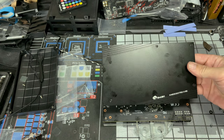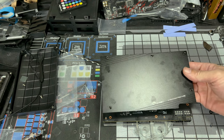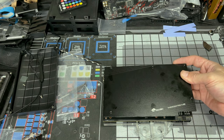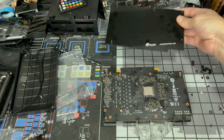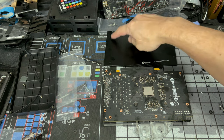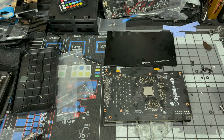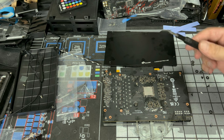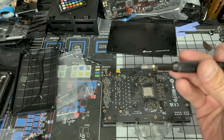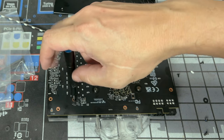If you look at your backplate, you're gonna see 5 outer screw holes, or however many you see on yours. So you're not gonna wanna screw those. You're gonna screw the ones on the inside. So just leave this here as a reference, and you're like, okay, I don't wanna do that one. I don't wanna do that one. I want to do this one. Just make sure you don't use the ones that are for your backplate. These are the same screws that came out of the bag with the spring screws. I think these are M2 screws right here, and we're going to put them where they belong. And just go to their snug.